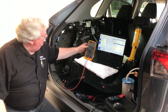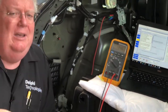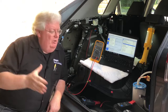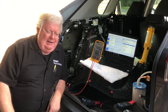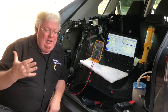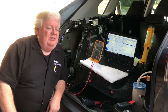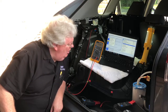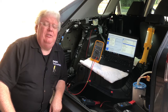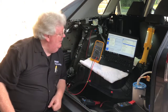Turn the meter back to just good old-fashioned volts. Now normally you have to crank the engine or turn the key on for a few seconds to get that initial prime, then the fuel pump shuts off. Well, this fuel pump is no different in that respect. We're seeing 13.4 volts. If you had a no-start issue — a fuel delivery issue, sprayed starting fluid and it came to life — and you're checking the fuel pump: this is a pump that's not running right now. You look at the pressure on the data parameter and it would say zero psi. So we have no pressure, the pump is not running, and it's getting 13 volts. We're not pulsing it — that's the difference.